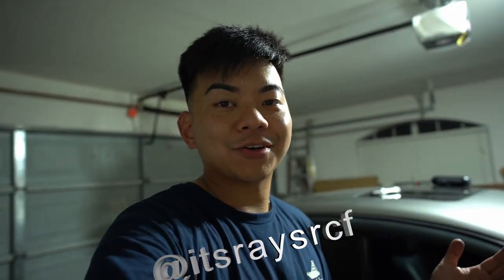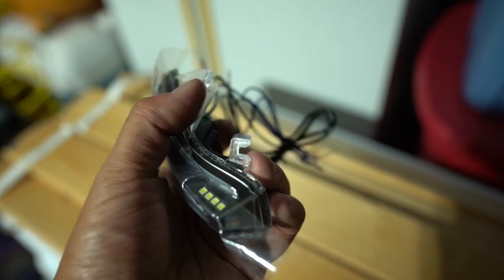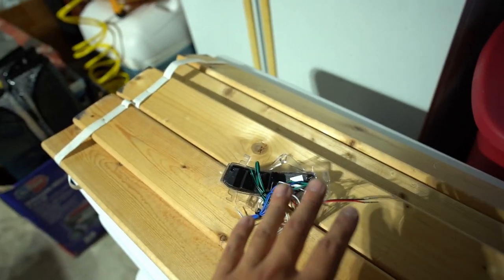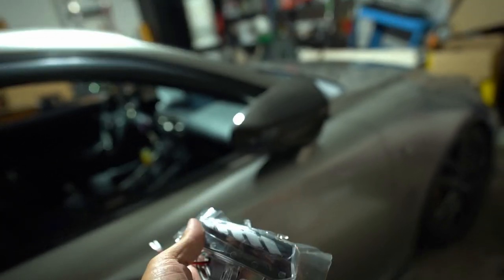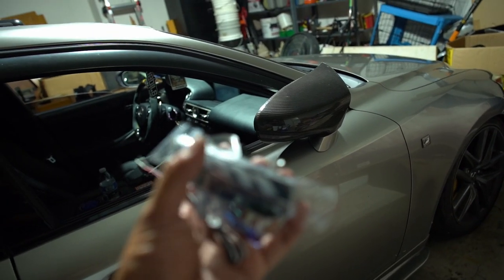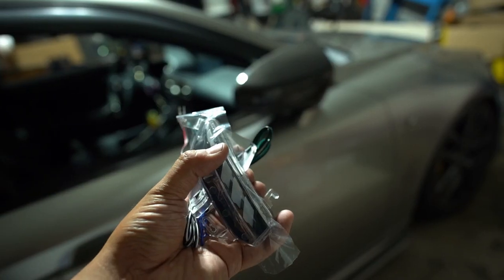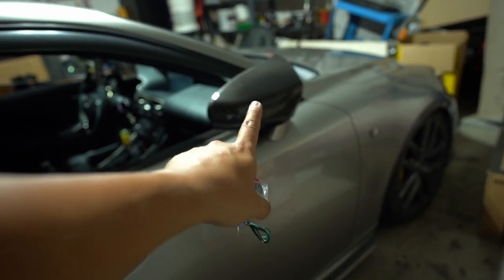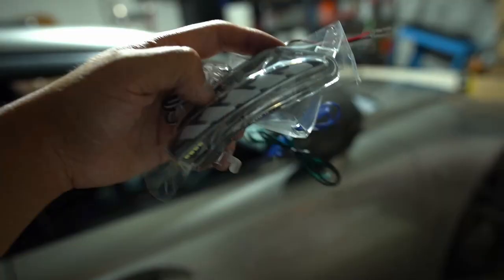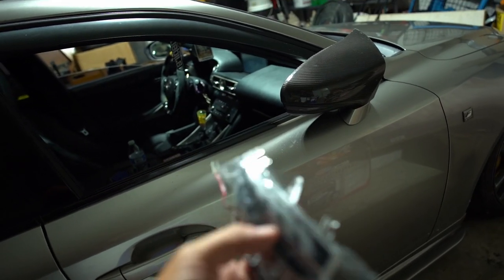There is another version of these LED signals. Ray's RCF is actually providing me with some — thank you for sponsoring this video. These different model ones have a frosted LED lens inside and a clear lens outer side. They have many wires because they have many functions. This specific model can blink on and off like the OEM one, it has a sequential amber mode, a DRL mode that turns white when you're not operating the signal — a switchback LED. It also has an additional puddle light on the bottom and a dancing animation mode at startup.